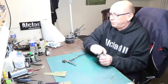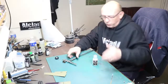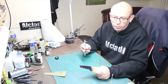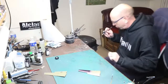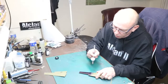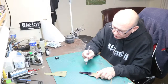But yeah, Aqua Gloss is simple to use. Do not shake this bottle. You'll get bubbles and not good. So there we go. Fred's going to laugh at me again because I'm always moaning at him. And that's all dry. So all we're going to do is, oh, it's still high, isn't it? Because I blasted. Back down to 10 to 12. And all we're doing is light coats. If it looks wet, it's too wet.